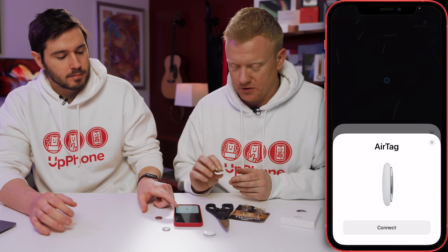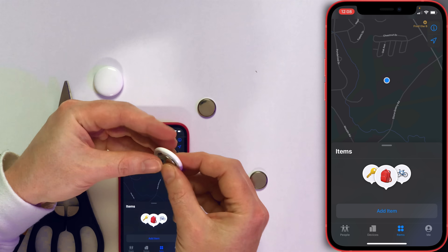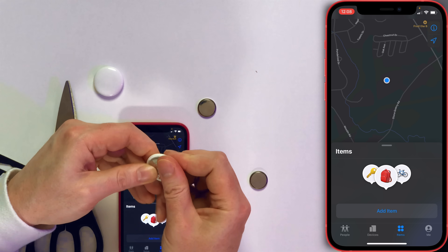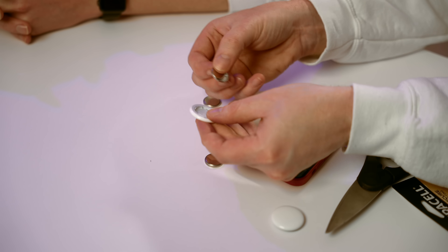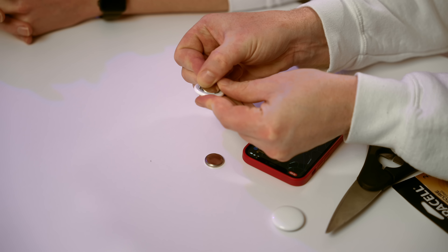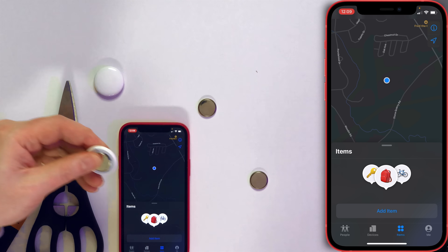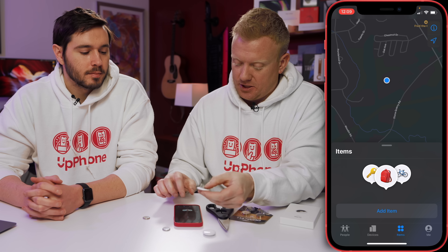But watch what happens with the Duracell battery. If I put it in, you don't hear a sound right off the bat. Obviously we can put the back on and we're not going to hear a sound. So I'll take it back out. What I noticed is that I can angle the battery in like this and all of a sudden we hear a sound — unbelievable. That's what it's supposed to sound like. But as soon as you put the back on, that connection is lost and it will not detect this AirTag.